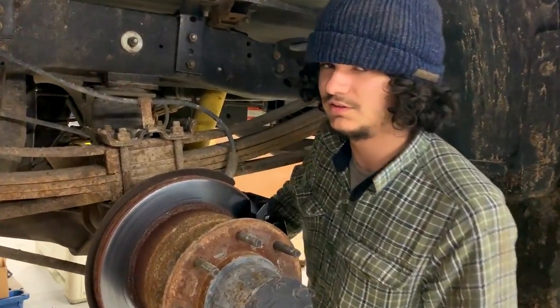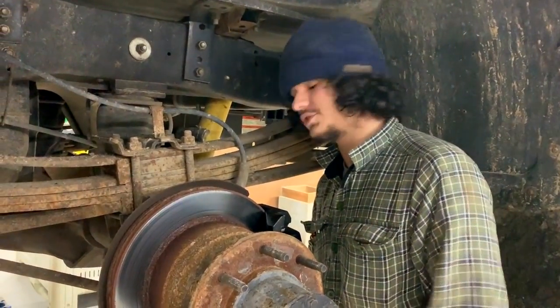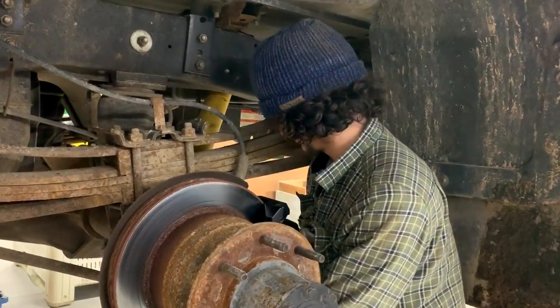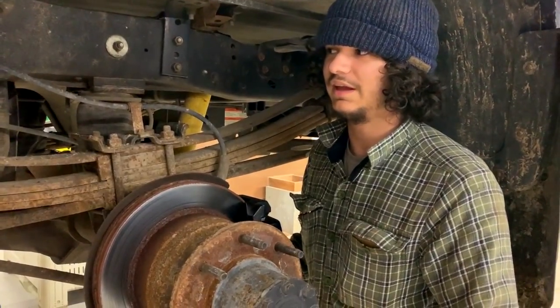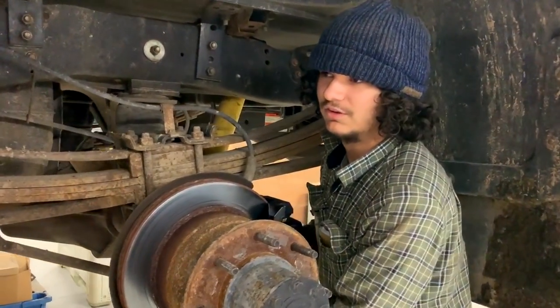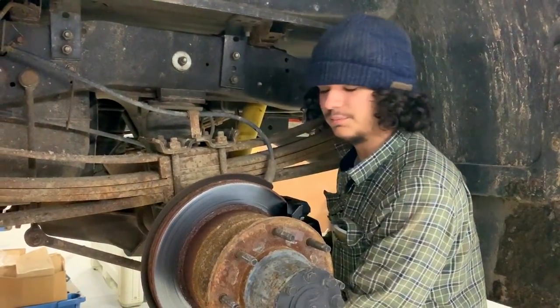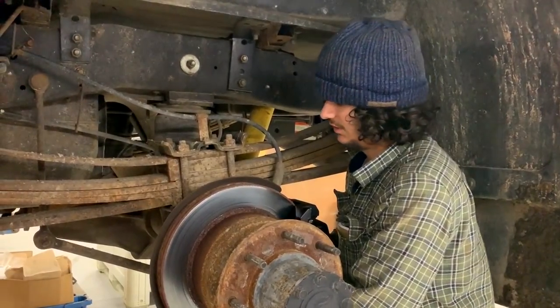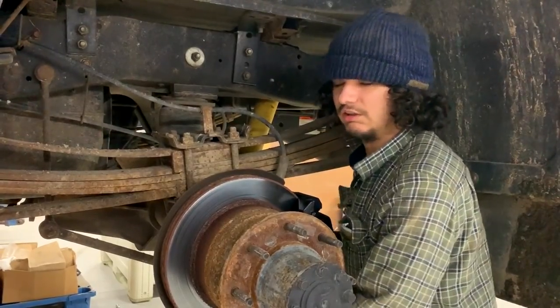If you really want to be accurate, you can check your torque spec for this stuff. I don't know if something like this would be in the manual, but I'm sure it's online somewhere. So the way I kind of do torque is, look how thick the bolt is. That normally indicates how much force is going to be on that bolt. So generally, the thicker the bolt, the harder you go. But you can also tell by how hard it was to take off. And even these 21 mil bolts here, they weren't that hard, so just go in between snug and tight. Most mechanic shops just use impacts on everything, so I don't think you can trust them.